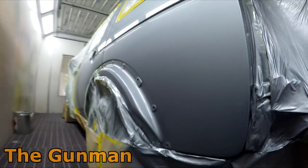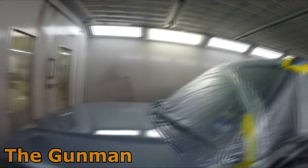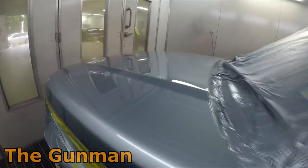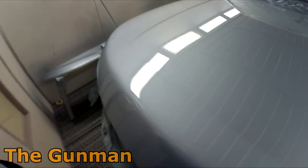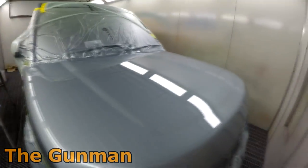It went quite nice, fairly clean. Had a few chunks of crap — I reckon they must have landed in the bonnet from when I was painting up here, but the bonnet was actually quite clean when I finished painting it. Oh well, they'll polish out. There are loads of stone chips all over that and considering I didn't prime it I've actually done quite well to get rid of 98% of them. You can very slightly see one there in the metallic — just a slight stone chip. The repair looks nice, the repair through there looks nice, all those parts came up okay — the blend came out alright. Pretty happy with that.